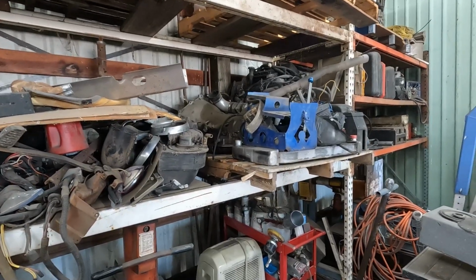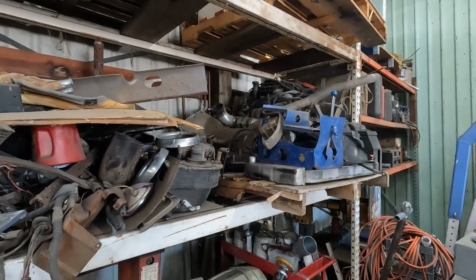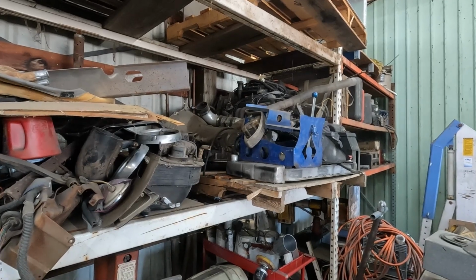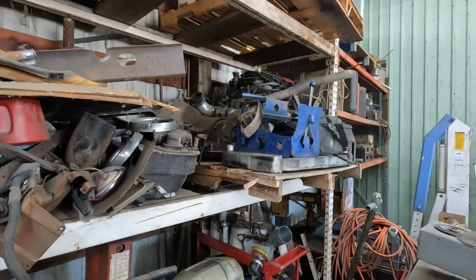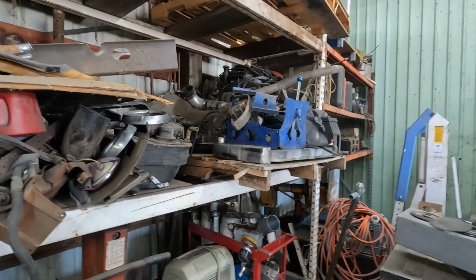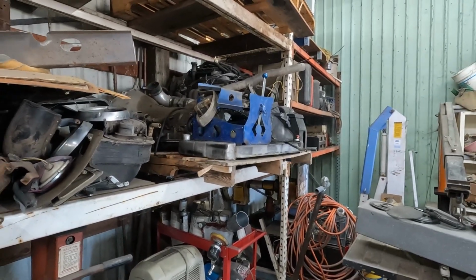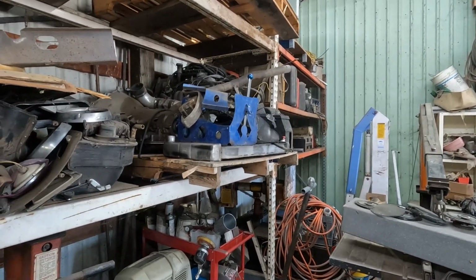Interesting. I did something similar without messing with the valving with the old Eclipse that I had. You could hook it up and bypass the relay so that it wouldn't shift. When you flipped a switch, it would go through a shift box and bypass the solenoids. And then if you want to shift up, you press the button and it shifts up. Press it down. So it's kind of like flappy paddles, but buttons and stuff. CompuShift did that too on my Ford conversion for a while.